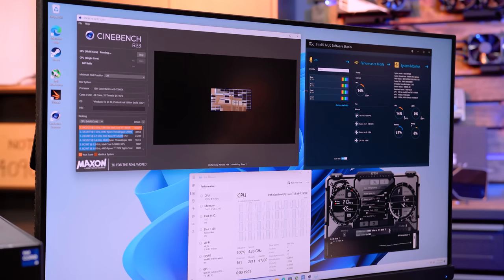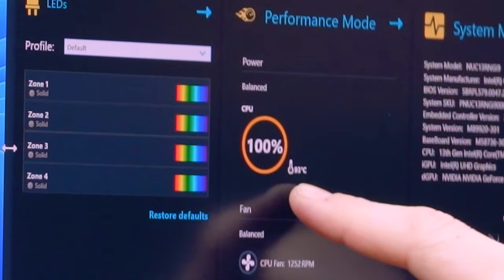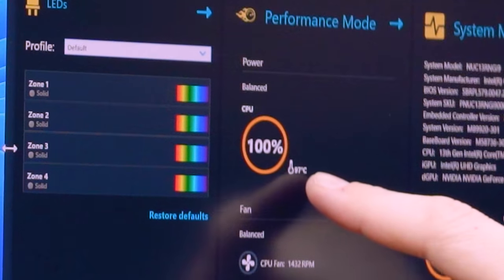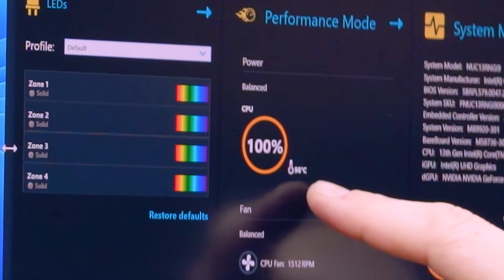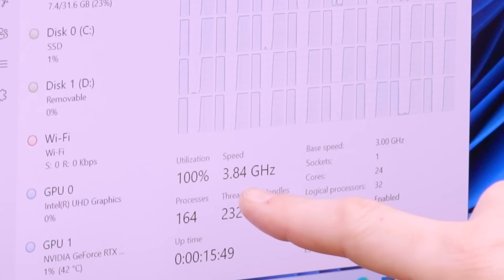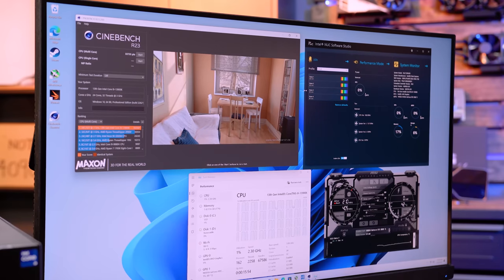Single runs aren't enough to really saturate coolers. Running in loop mode now: 92, 93, 95, 96, 97, 98°C, dropping to 82°C — and we dropped all the way down to 3.85 GHz. That score is going to be much lower: 33,785. We definitely have a saturation situation, which is expected. Cinebench R23 uses the AVX instruction set, which is known to pound CPUs — it's above and beyond the typical use case.